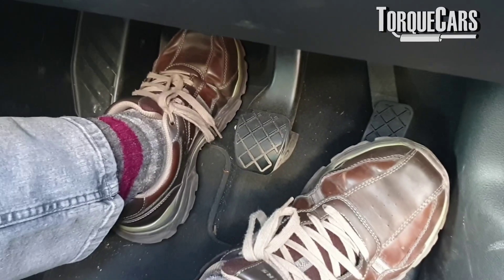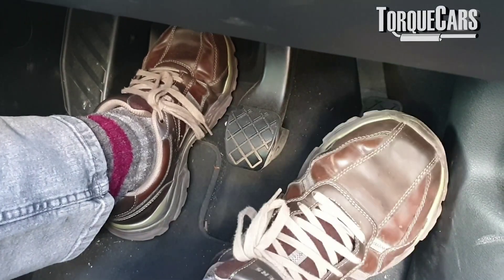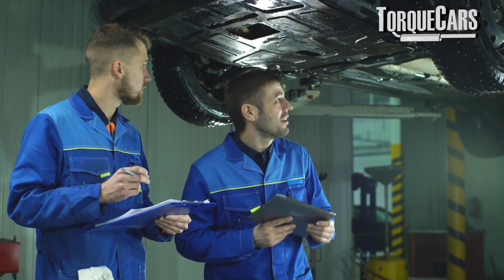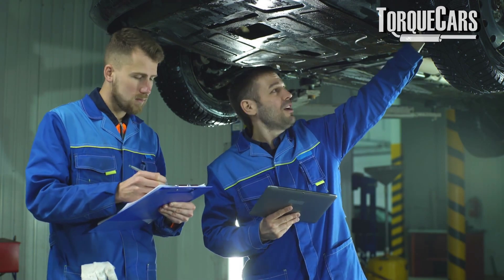Here in the UK there's still a massive amount of cars with manual transmission, so that gives you another opportunity to sense a problem with the flywheel. These dual mass flywheels are generally good for about 100,000 miles. Often when people replace the clutch, they view that as an opportunity to change out the dual mass flywheel as well — or if the dual mass flywheel has failed, they'll do the clutch at the same time. It makes sense, since you're going into the same area of the engine and gearbox housing, so the same amount of work is involved in changing both items rather than going back to do the other one 10 or 20,000 miles later.